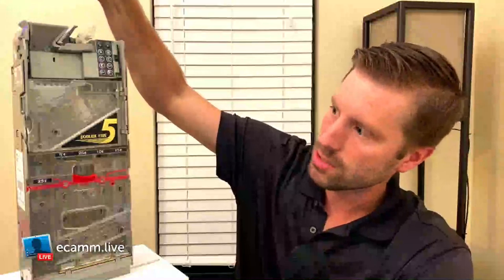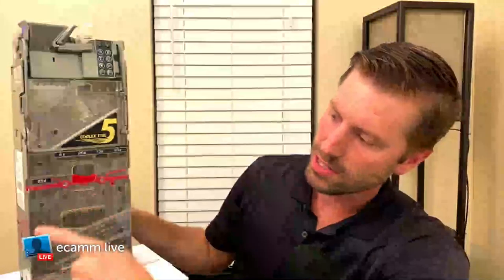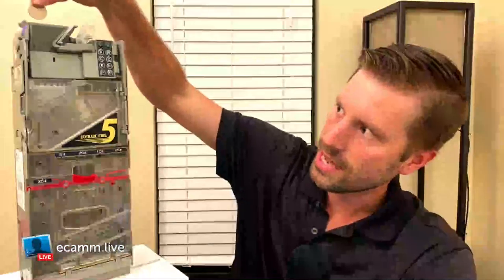Reason number two — now we're getting into the nuts and bolts. This is the cassette. A quarter comes in from the top of the vending machine, down the chute, and goes into one of these tubes or into the coin box. If you need to fill the coin mech, you've got a couple of options. There's a breakaway slot right here where you can fill it with quarters, the same for nickels or dimes.